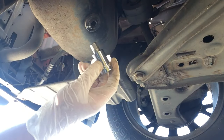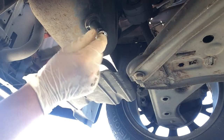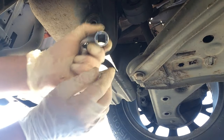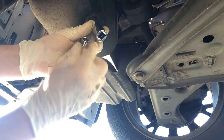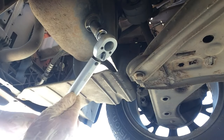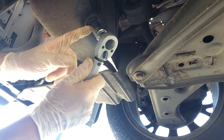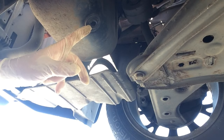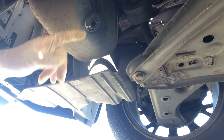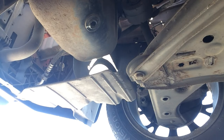With this engine I needed to buy a 12mm Allen head and I need a half-inch square drive adapter, and when you get your torque wrench on you'd never get it in there. You wouldn't have all these complications if it was just a hex head and a quick spanner. The major difference is this type requires 45 newton metres of torque when doing it up, which seems excessive, but you definitely need a torque wrench. The nut-head type only requires 20 newton metres, so you could almost get away with just doing it up spanner-tight.